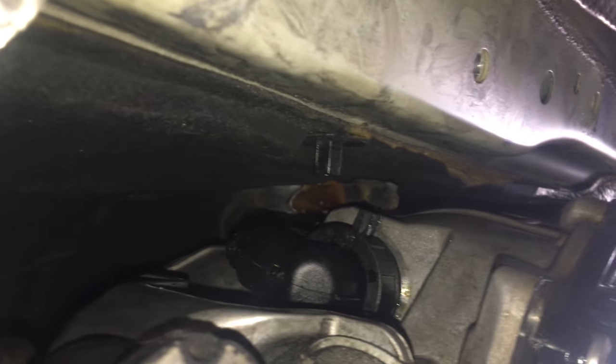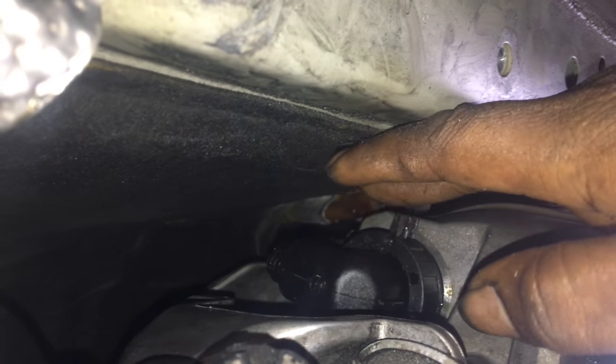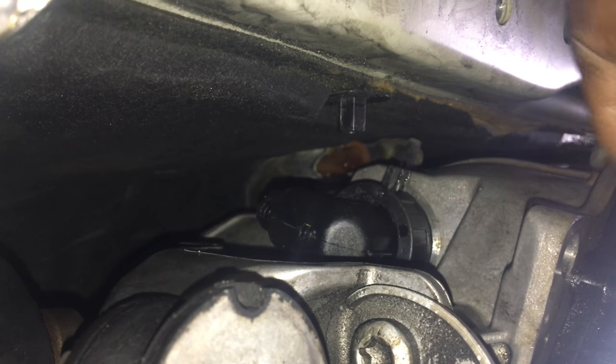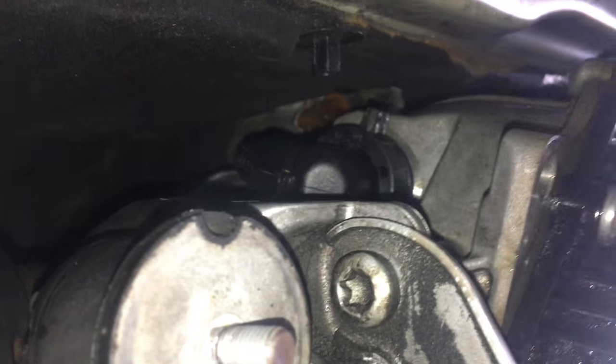Found the issue — this plug right here wasn't tight enough. Had to take the whole transmission support out, push it in, and use a flat tool to lock it in tightly. When I hooked up the scan tool to the car it told me there were transmission issue codes and couldn't communicate with it. The only part I had a hard time putting on was this one — tight quarters and I hadn't removed it before. Going to try again now.